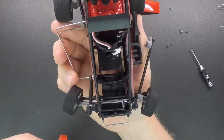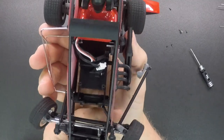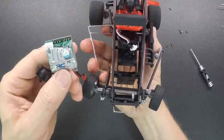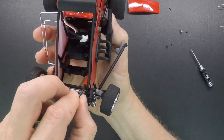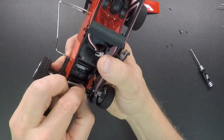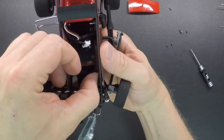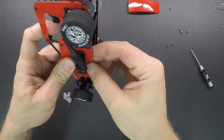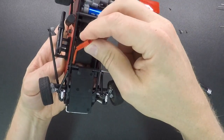When you go to put this back in, some people just put the wire down on the side of the battery box and don't go back through that little channel, but we do recommend putting it in that channel — it just makes everything a lot cleaner and the battery wire fits in the car better. Feed the red plug down between those two screws and fiddle with it a little bit. You can pull the frame away from the battery box if you need to. Go back from the bottom side, and as it pushes through you can grab that plug — use your driver to pick up on it if needed — and just pull it through until the wire comes out a little bit. That's all you need.